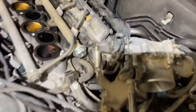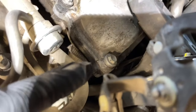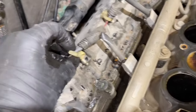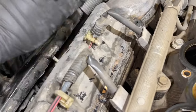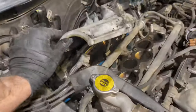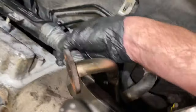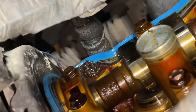We're taking a 10mm socket and coming back here to take off all of the bolts that go around the valve cover. There are also little pins here that go on the studs for our fuel injector clips — pull up on those, and you'll see they're brittle and can break. Make sure none of it gets down into the intake manifold. Now we can slide the cover out. On the driver's side it has the cam gears, so you have to really pull on the harness to get it right up against that EGR, then slide the cover out. Just watch those two gears on the far driver's side — that's where you don't have clearance. You can see all the buildup that's down in here.